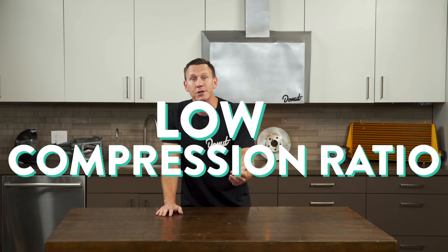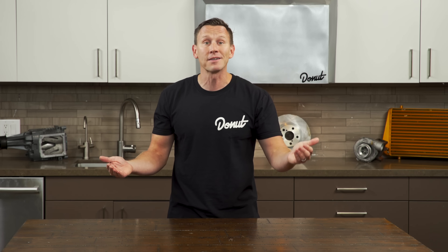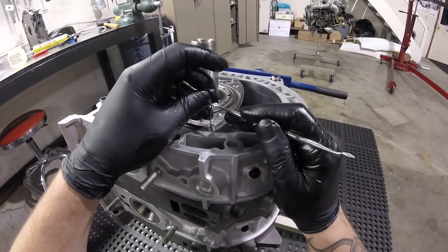But that's also a drawback. Wankels use a lot of gas because they have a low compression ratio. When they get moving like that, they shoot out exhaust gases with unburnt hydrocarbons — not good for fuel economy or air quality. The engine is also lubed with oil throughout the housing, and that oil burns when hot, meaning more unburnt hydrocarbons and tougher emissions. And you can blow an apex seal — if that happens, the chambers bleed into one another and you lose most of the benefits that made you fall in love with your screaming rotary engine. Between being different and being good, Wankel Rotaries are pretty rad!